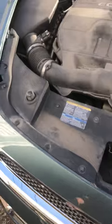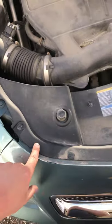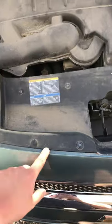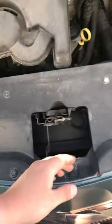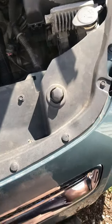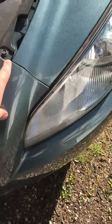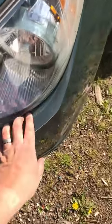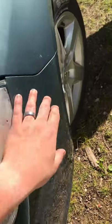You're going to want to come up here and take all these out — all these little pop-in tabs and all these bolts. They're all 10 millimeter. Pull this shield up and out of the way. Then this liner will just start to pull back — they just sit in little grooves. You start back here and just pull it out, and it'll all pull up from there.